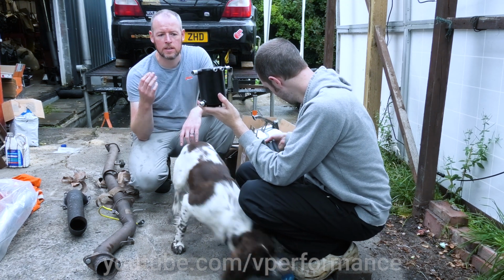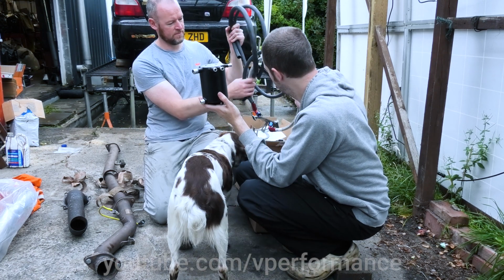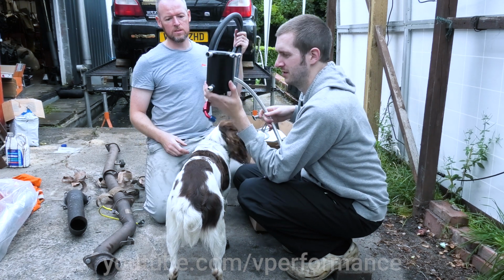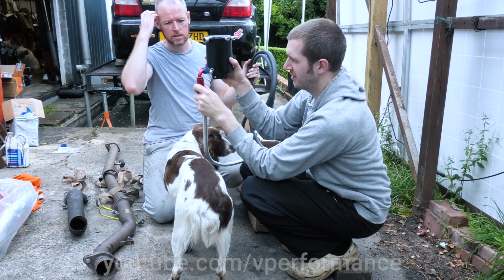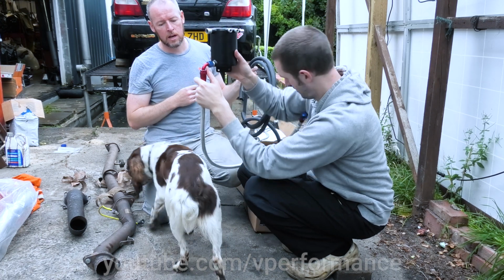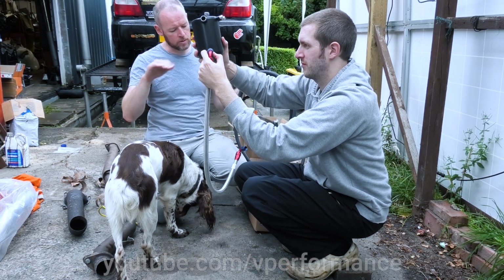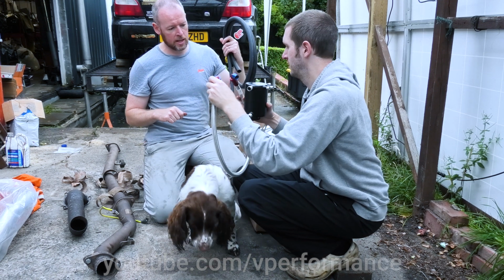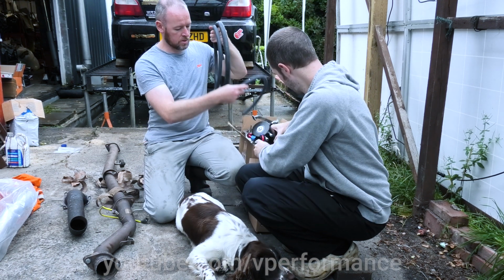There's your generic hose. That's your custom kit right there. This is the only one that's custom. This is the one that fits. I thought that was fuel hose. No, that's the end fitting for return to sump. So return to sump, good. There's a breather system on the Subaru already. This gets rid of all of it, doesn't it? Yes. So catch can, return to sump, and gets rid of the breather system.